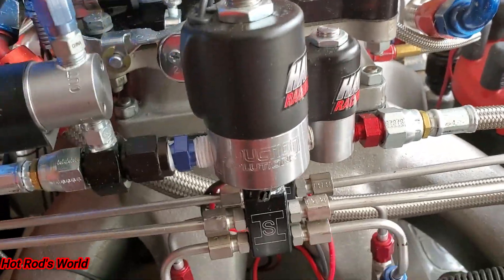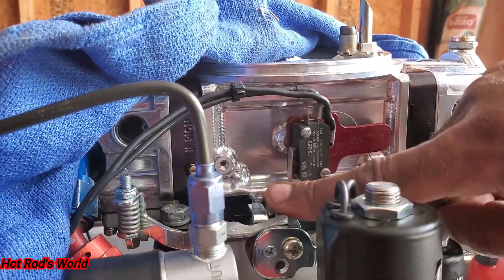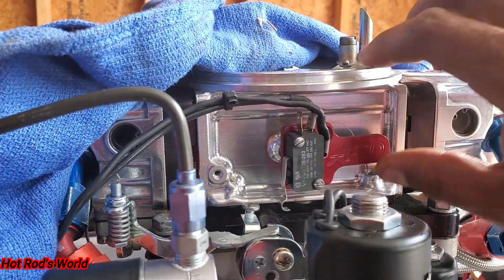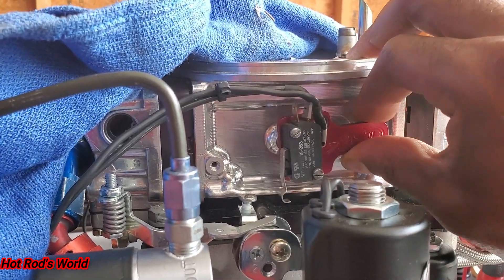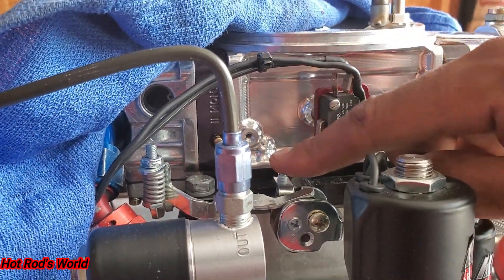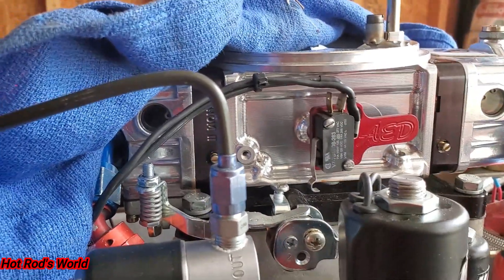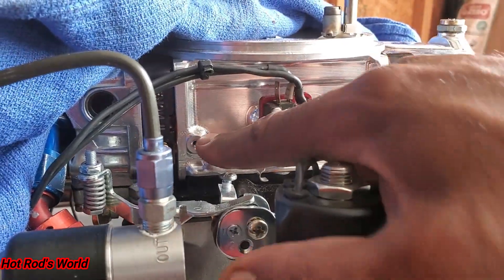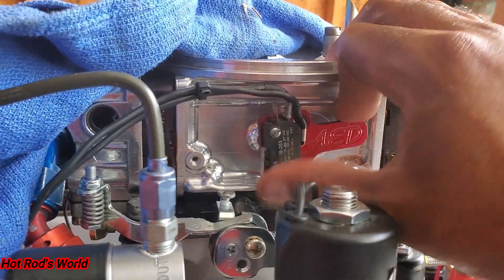What I found was this: for people that don't know, my micro switch — this button clicks this — and on my old carburetor I actually had two buttons, but on the new one this issue could happen. I'm guessing it wiggled because I was sitting there trying to adjust the idle as the car got warmer. I was adjusting this screw — you can see I put some Teflon tape. Normally there's a spring behind it, so I'll look to make an adjustment. I ordered a new micro switch that connects here and at this post to keep it from wiggling and causing me to lose signal.